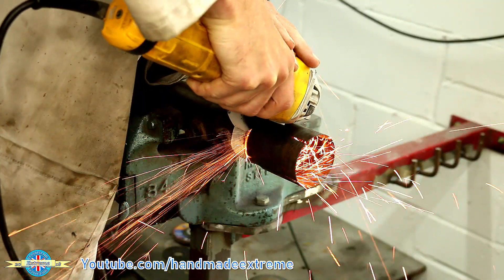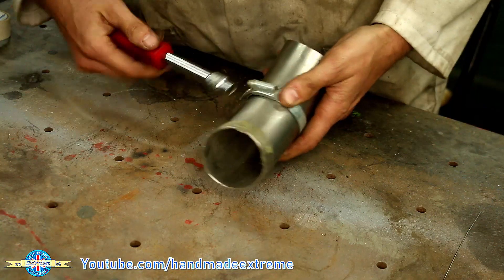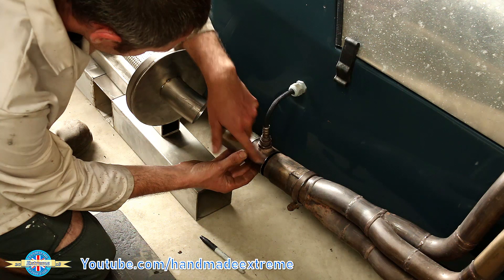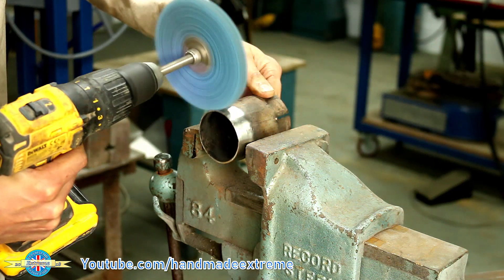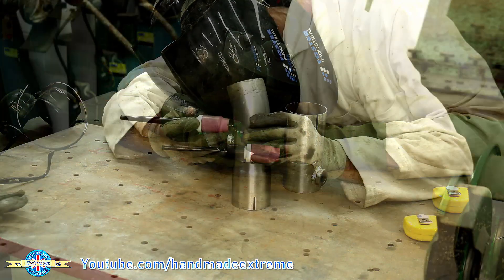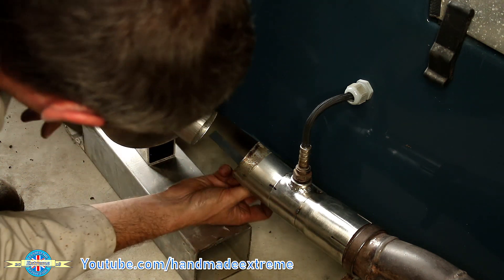I've salvaged the fitting off the end of the old exhaust, and I can put that on and offer up a couple of bits of tube to work out how I'm going to get from A to B. To cut around the bends, if you put a little jubilee clamp around them you can draw around it and that gives you a reasonably straight line. I can get these bits all tacked together and cleaned up — a run over with the strip and clean wheel on the outside, and a sanding disc to go around the inside so the stainless doesn't get contaminated at the weld. A couple of tacks to put it all together, then I can offer that up and measure for the last piece — a nice straight piece to finish.